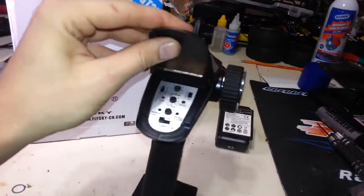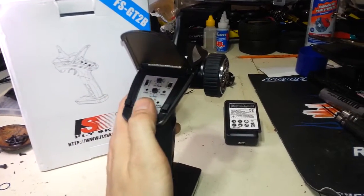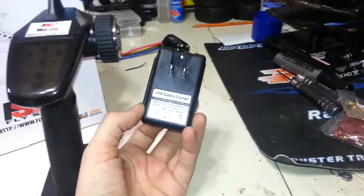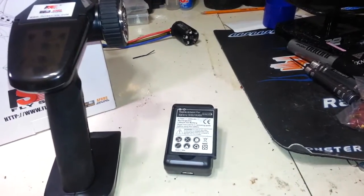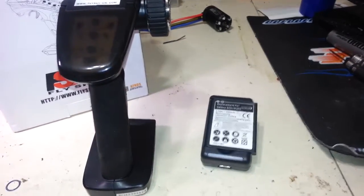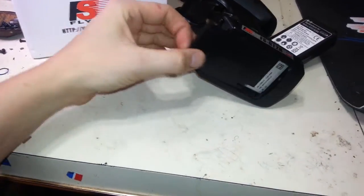Well, I went through and did a little mod of my own here, and it works great. So basically I have a Samsung Galaxy S3, and I purchased this little guy. It's a charger, but also a battery. I was looking at it — 3.7 volts. It's basically a one cell lithium ion, but a very high milliamp rating. It's got 2,500 milliamps, whereas the included one has 800.